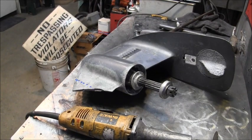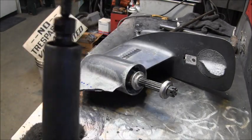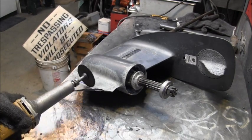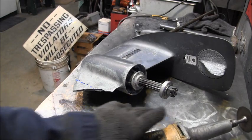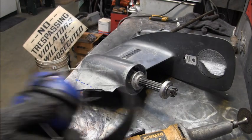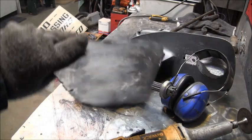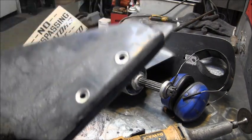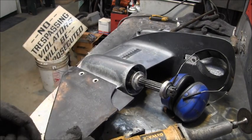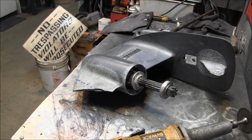So, if you see my dotted line here, I'm going to take the old Diablo tool and cut straight across there. You've seen this repair I do before. You can see a big chunk of the skeg's missing. Then I'll take one of these hydrofoil fins. I have a bunch of these come in on these old used motors. I'll bolt it into there and shape it the shape I want. You'll see.